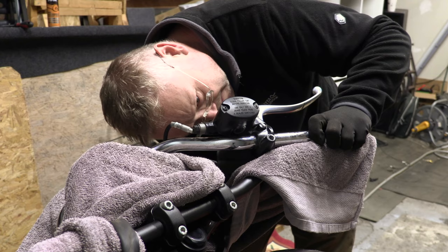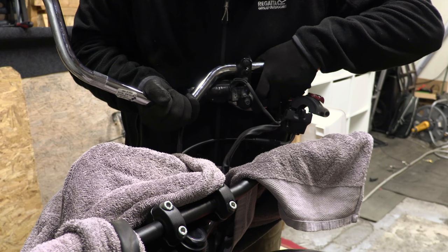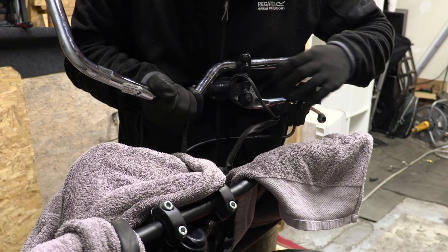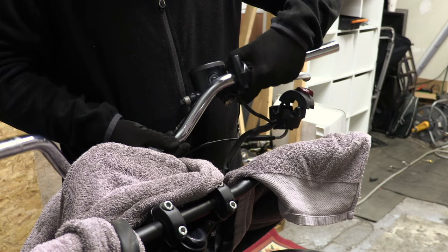Now, the reason that wouldn't come is because I was too impatient, and the throttle switch gear, obviously the front brake switch is there, which is that sound that clicks when you brake, and that's what turns your rear stoplight on. It's a little bit corroded there, I'll have to give that a clean up. And they should be pull-off spade connections. I'm a bit worried they might pull off the entire switch connections because that's quite corroded. So I'm going to see if I can unscrew the switch.